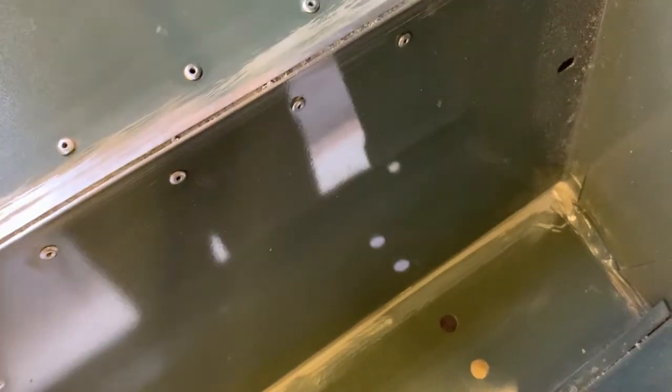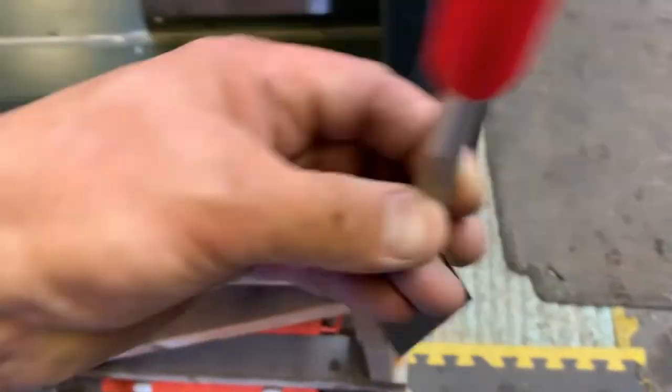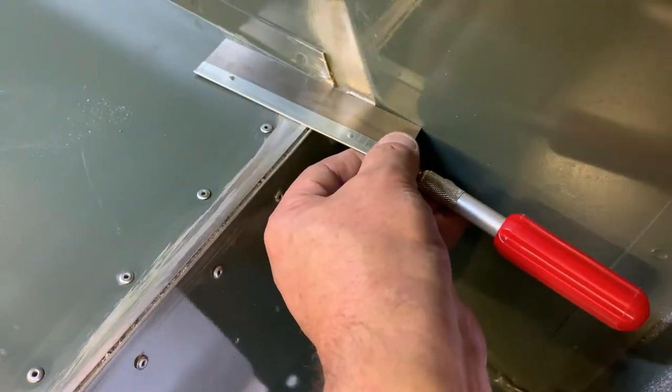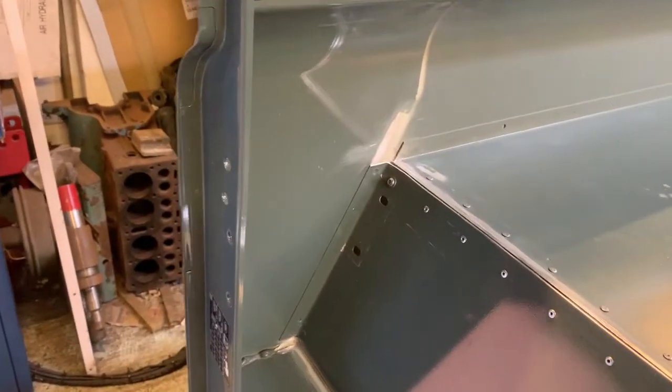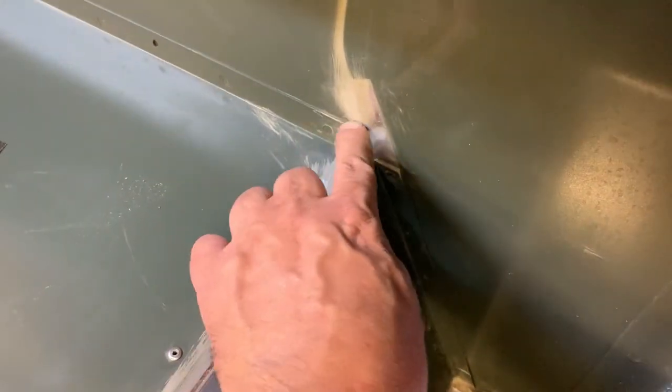On the sides here, I managed to, whoops, basically that tripod fell apart in the end. Yeah, on the sides here, I managed to cut this out with a modelling tool. It's called a razor saw. So I'm just able to get in there without the handle on, and just literally saw through until it's almost all the way through, and just snap it off. And it gets a nice neat job, as you can see on the top of that flange then. So as I say, we'll put some seam sealer over all of this, seal it all in.